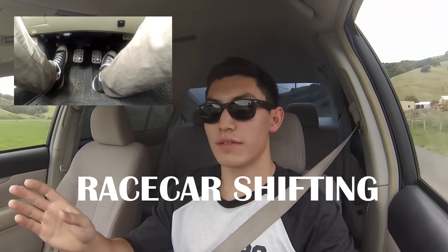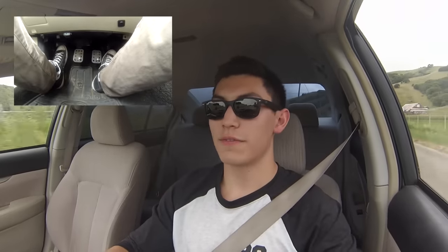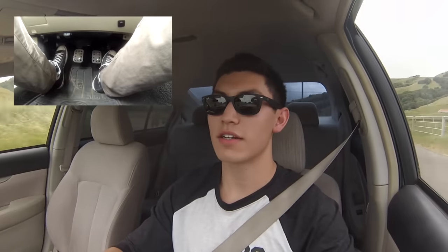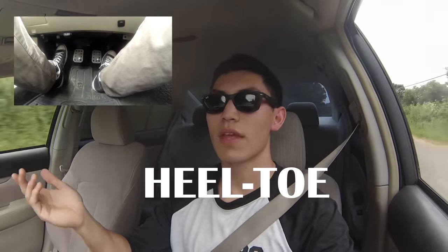Last thing — heel-toe. Well, it's not really race car shifting, it's just heel-toe. You can actually use it a lot in your day-to-day driving. If the person in front of you suddenly slows down and you've got to shift down gears, it's easier to put it in the next gear instead of dropping it to neutral and trying to get back in gear. That's also safer too. What the heck is a heel-toe? Well, we have two feet as humans — most of us at least — and we have three pedals in a manual car. So how do we get on the brakes hard and still downshift? You need to blip the revs. Heel-toe. As you're braking, you move your right foot over and hit the gas. It's exactly the same as a rev match, except you're decelerating and you're using all three pedals.